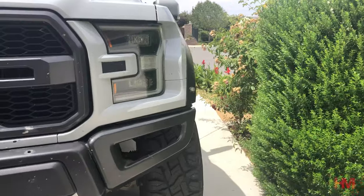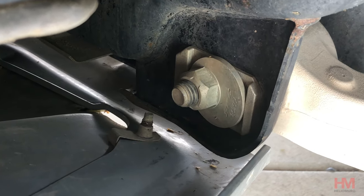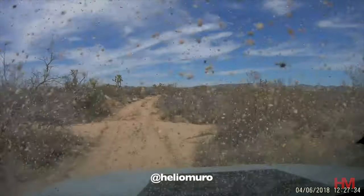A lot of you guys with Raptors or any off-road vehicles will notice every time you go out the alignment gets knocked out. Some of you do the Firestone Lifetime alignment, but you really don't need to do that. What you need is a caster camber kit, which locks your alignment in place on those lower control arms. The kits are actually strong enough to deal with off-road abuse. Ever since I got mine installed over a year and a half ago, I've only had to go back in and do an alignment once — and that was after I bent the frame. Yeah, that sucked — total lawn dart in the desert.